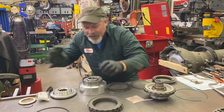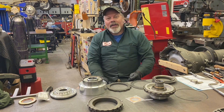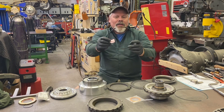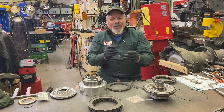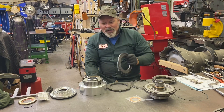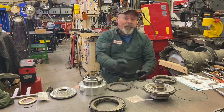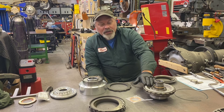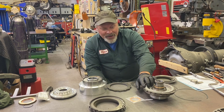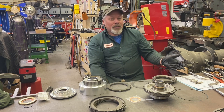Yesterday when I was talking about it, I bought some 4L80E intermediate snap rings and they were right around 100 thousandths — I think 95 thousandths. Well, the one they gave me — the WAPA, the big thick one — is 107 thousandths thick, which is also going to cut into your clearance, or lack thereof. I don't know how this is ever going to fit, but in the near future we'll find out because this is all for me. I had a passing thought that maybe their billet piston was somehow thinner, but when you put the beveled snap ring where it's going to live, you don't have a lot of space to gain right there. I don't believe that is where they're gaining the clearance, nor is there any mention of it in the minimal instructions that came with it.